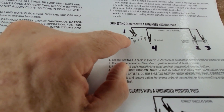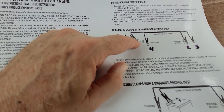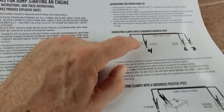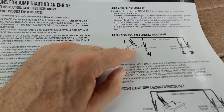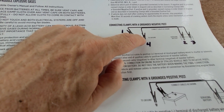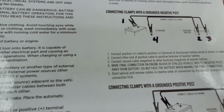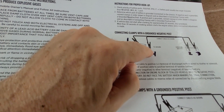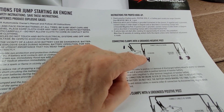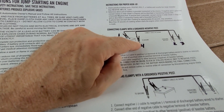A lot of people will connect it directly to the battery, but there are many warnings against doing that. You could have fumes coming out — you don't really know why the battery is low or went bad. It could be defective and could explode. So they don't want anything that can cause a spark near the battery. You stick it on the ground. I'll show you where that ground point is in a Toyota Sienna, Toyota Highlander Hybrid, and a Subaru Forester.